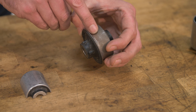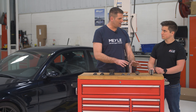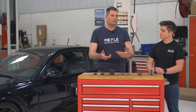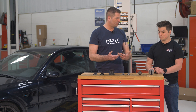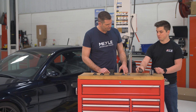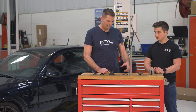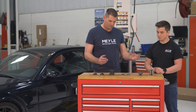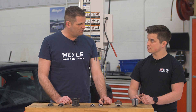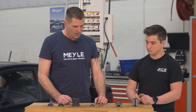There is a maximum pre-compression of 50%, which is what the rubber can handle — not more. That pre-compression is already leading to a lower stress level. So it's as simple as this: press the old one out, press the new one in, and it has exactly the same diameter. You're done. We're going to see more of those as well, next to the slot bushings that people have to compress by themselves.